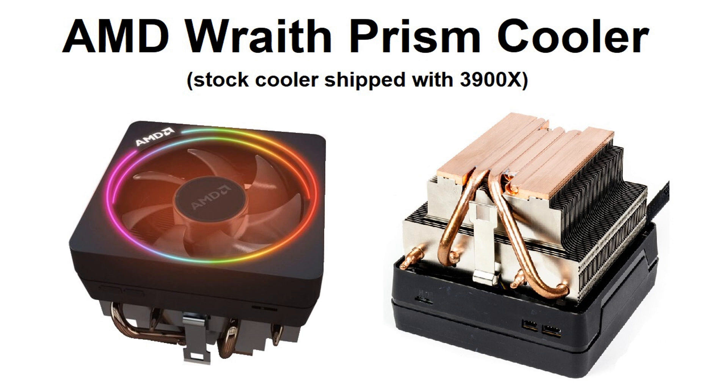When I first set out to test these two phase change materials, I was using an AMD Wraith Prism cooler on my test bench. It's a good cooler, but I found it kind of difficult to keep taking off and putting back on with those little tension clips — I had to basically take the GPU off each time. I also found out I'd be receiving a sample of basically a liquid metal cooling paste, so I decided to change my cooler to something with an even surface and nickel plating. But I'm going to show you the application of MX4 as well as PCM1 with this AMD Wraith Prism cooler, just so you can see how it acts when there are little gaps and channels.